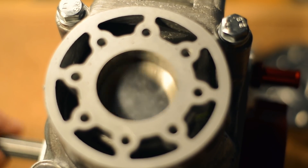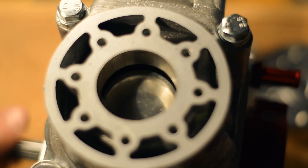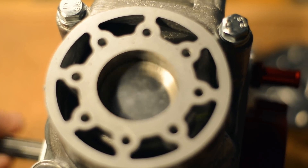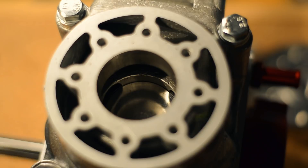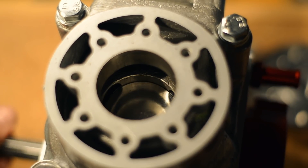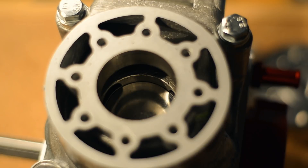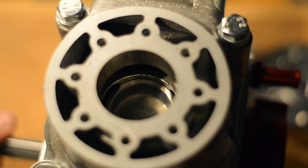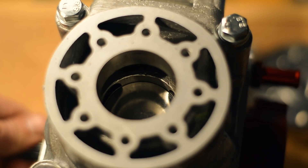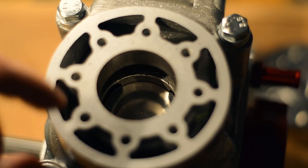So far so good — seems to be working just like any other two-stroke when I turn it by hand here. Here's a look at another feature of this cylinder which I think I haven't mentioned yet. The exhaust floor is raised. It's much higher than the transfer floors. Might be too much, but total exhaust area is pretty much unimportant. It's the blowdown that matters, and there's a lot of blowdown here. This raised exhaust floor will definitely lead to less short-circuiting between the A-transfers and the exhaust port.